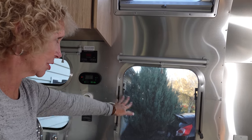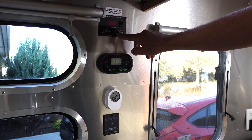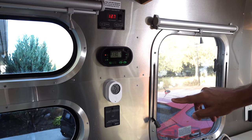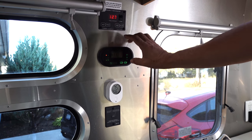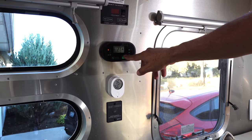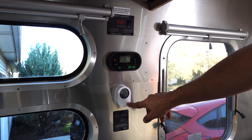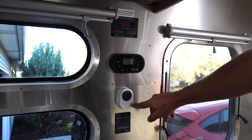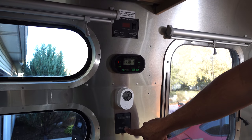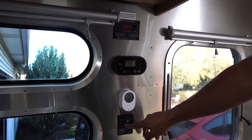This is the control panel area of the trailer. Up here is a CLS level tank monitoring system that gives you black water, gray water, fresh water, and battery status. Below that is the Zamp solar charge controller remote panel — the actual controller is mounted remotely — showing battery level, charging amps, and amp-hour readings. Below this is a remote temperature and humidity sensor that connects to an app on my phone, allowing us to monitor the temperature in the trailer so we know if it's getting too warm for the dogs. Below that is the inverter switch that converts DC to 110-volt AC, allowing us to watch TV and charge devices.